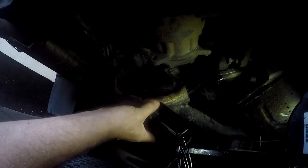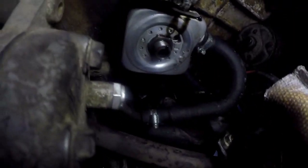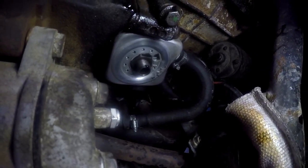When it is loosened enough with the chain, we can turn it by hand, but we need to get our oil catcher into position so we don't make a mess. Open it up and you can see that excess oil draining out. We turn it out all the way and make 100% sure that the seal comes out with the filter. Always have a rag handy to wipe up spills. We also want to inspect the flange — move the camera to the oil flange with some light so we can see it's looking good.